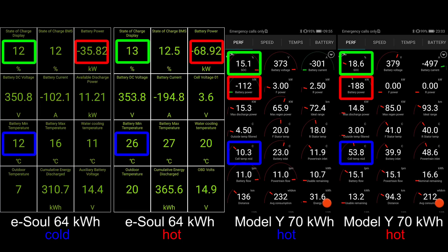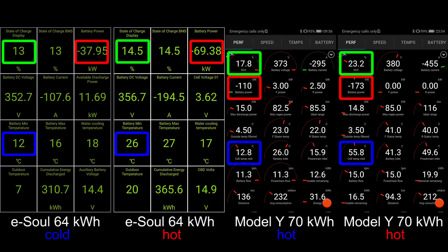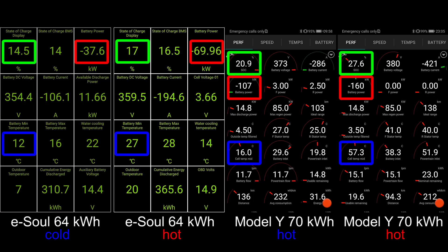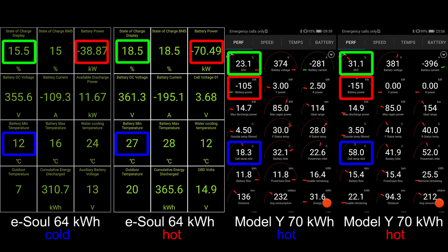Initially you will see that the water cooling temperature will rise soon, which means that the battery heater kicks in, and then it's charging kind of slow versus the hot session. Ideally you want to get 200 amp or close enough, but unfortunately we were not able to get it here. And actually there seems to be a little bit of a limitation on the ABB charger — it's supposed to be 200 amp, but I'm getting only 195 amp from it.